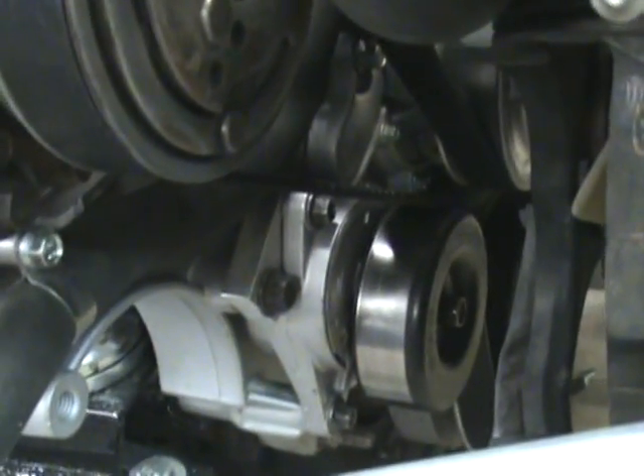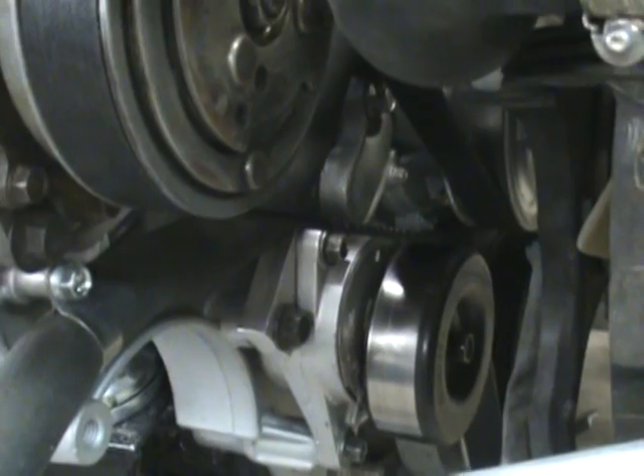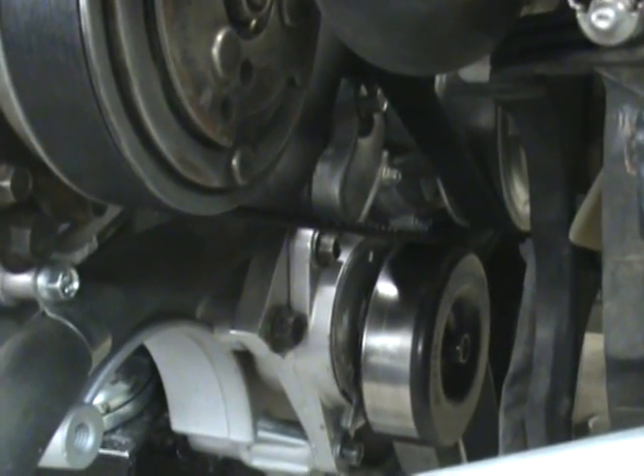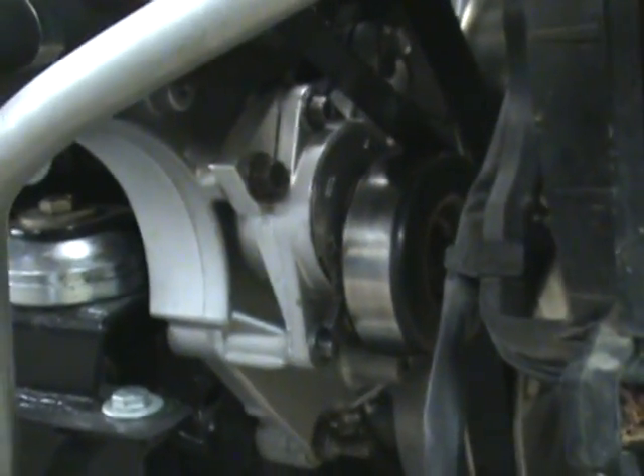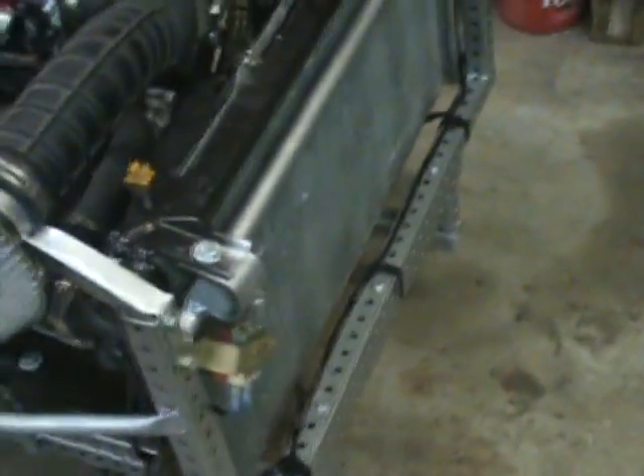One trick you can see: the heavy bar supporting the tensioner pulley — had to tip it up 90 degrees because the belt wouldn't really tension in this configuration; it was swinging right past its original mount. So it's just simple half-inch plate work. Great, nice and simple. Big Subaru radiator snatched from a local junkyard.